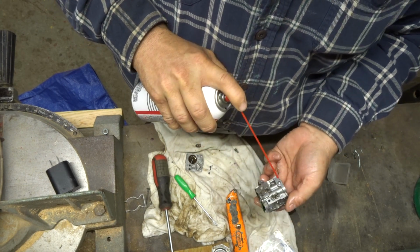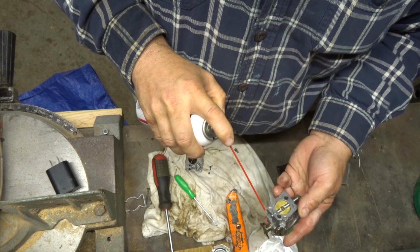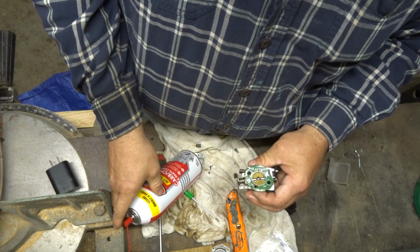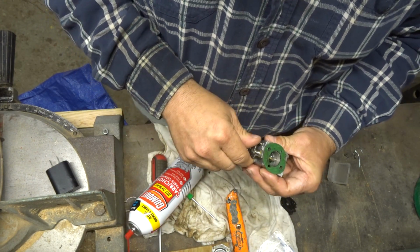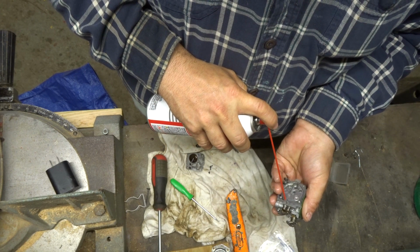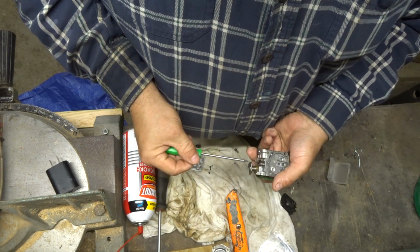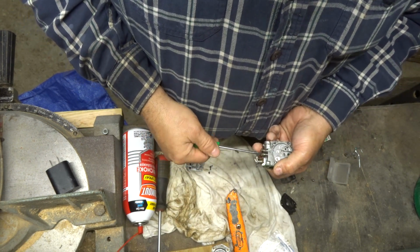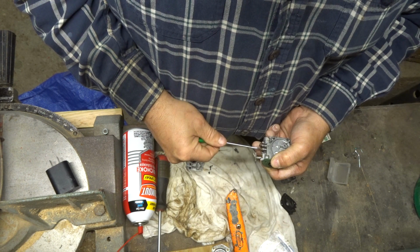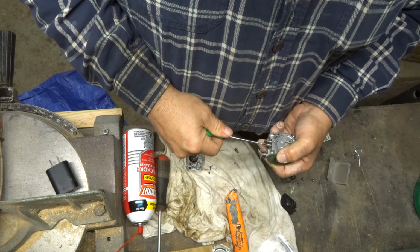Okay. Open it up. Down the choke. Anything looks like right there. Probably should pull these jets out. Well, let's see here. Let's see where they're set. Half. One, so that's set at, yeah, that's set at one turn out.